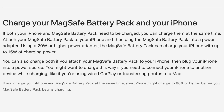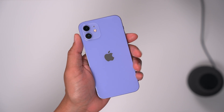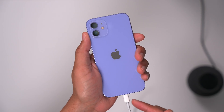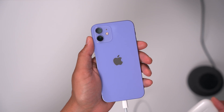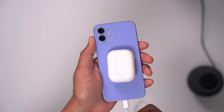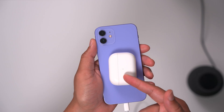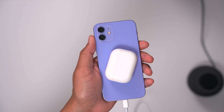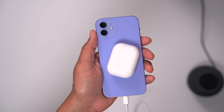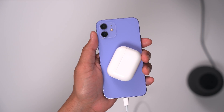Why would you want to do that? Say you were syncing photos or connected to a wired CarPlay setup that charges your phone — you'd have to plug in directly to your iPhone. According to this document, your MagSafe battery pack would still charge even though you don't have the lightning cable connected directly to it. In other words, your iPhone would be recharging the battery pack via its wireless connection — reverse charging. To demonstrate, if my AirPods wireless charging case were the MagSafe power pack, you can see how the iPhone, plugged into a power adapter, feeds power back to the accessory wirelessly. That would even allow Apple to enable reverse charging for AirPods in the future.